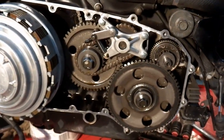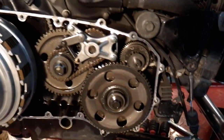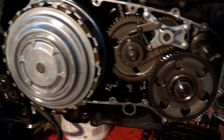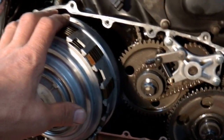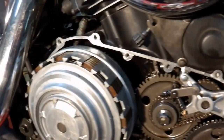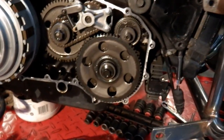Really the only thing left to do is put the clutch cover back on and put this section of frame back in — that wasn't a bad job at all. If you have any questions, you can send them in the comments. Those small springs I showed you earlier — those are basically for if you downshift too fast, or if anybody's ever tried to push-start one of these bikes, you know it doesn't want to push-start because of those springs. Those other springs act as a one-way clutch: if the back wheel is pulling harder than the engine, this will slip — it's made to slip inside there. Anyway, that's about the end of this clutch video. Maybe we'll make a video on something else. Until next time.